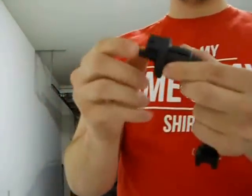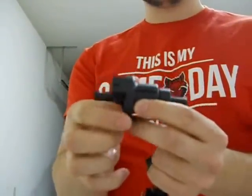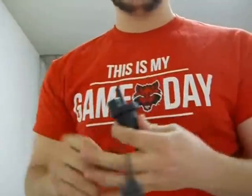The reason being, the fuel leaves the tank, goes through a couple of systems, and then up into this. The purge control valve regulates how much fuel vapor is going to go into the engine, so that's the outlet. The other end feed of this, you'll see there's two things that the hose is going to go on, and then you'll have this part that snaps on there. It controls from the computer. It regulates everything electronically there.